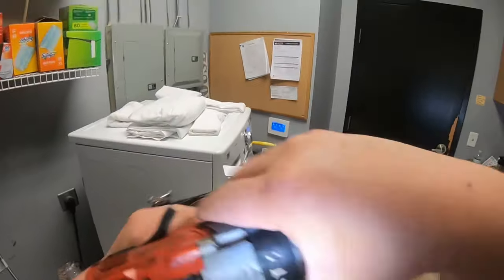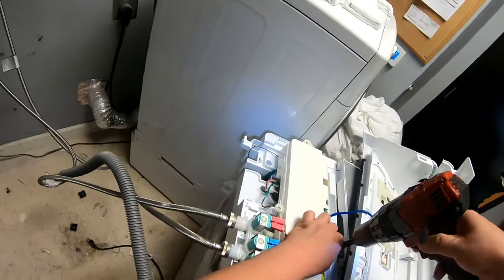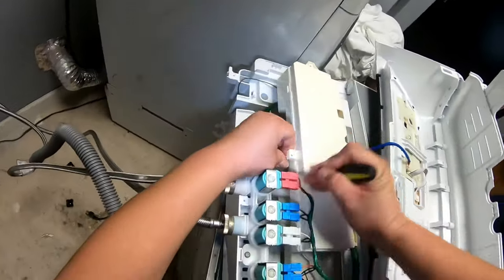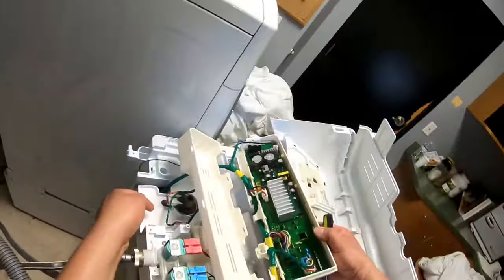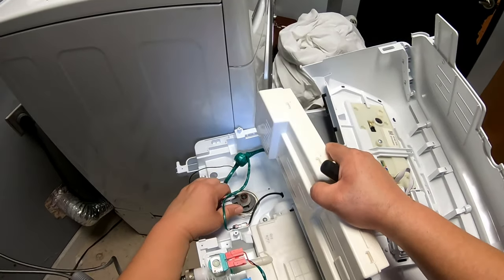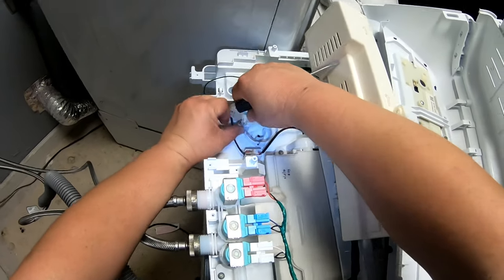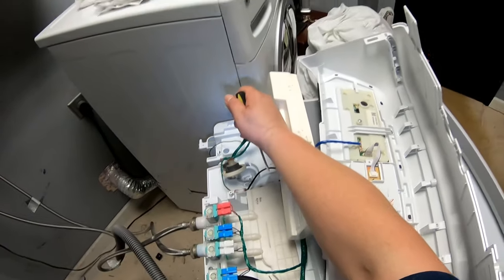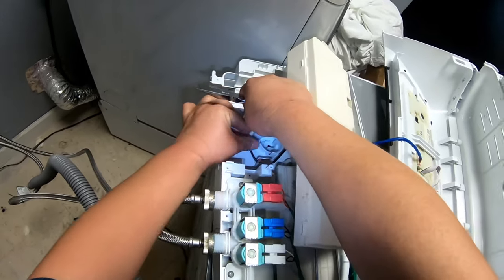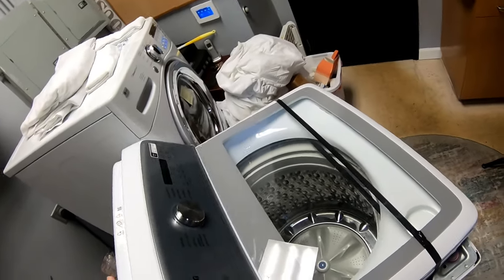The other thing holding this top panel is the pressure tube. The water pressure switch is on the bottom of this board, so all you have to do is remove these three screws. You don't have to open the main control board to access the water pressure switch — just remove it out of place since it's secured by two tabs. Grab a needle-nose pliers, remove the clamp, and you'll be able to get the water pressure hose loose.